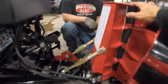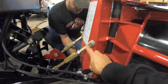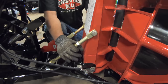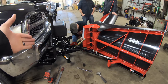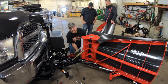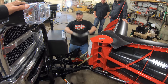You're loosening these up so the whole center mass column can shift to the ground, and then you tighten those back up — that's what keeps everything centered. These are actually what change the angle, while the other bolts keep it healthy. Do you have to readjust it as the blade wears down? Normally it won't matter much, because as you put the vehicle in float it should push down and your blade will wear evenly.